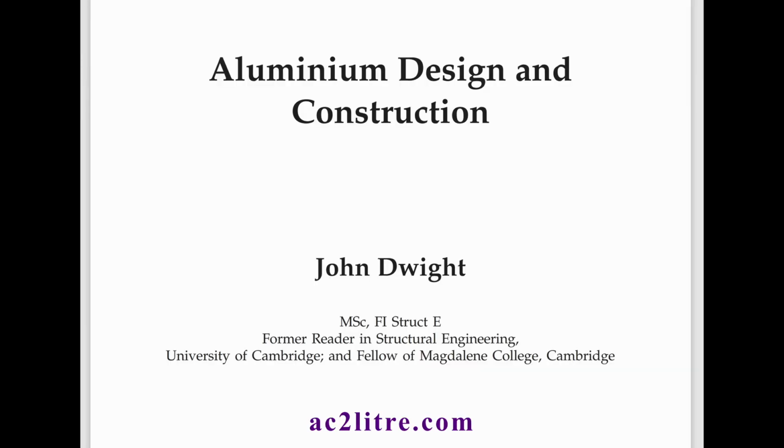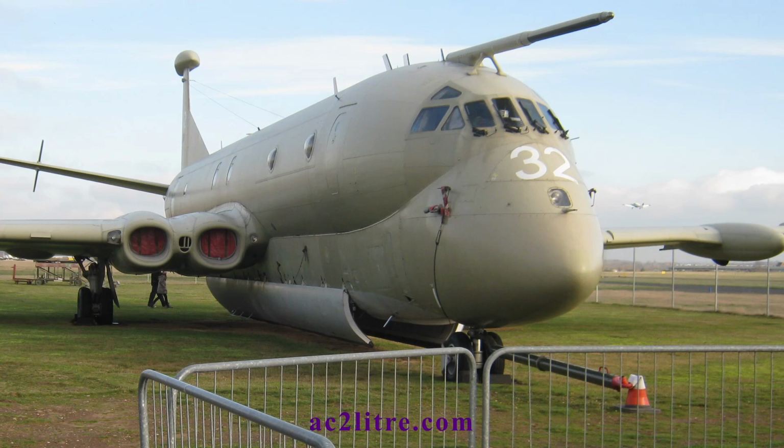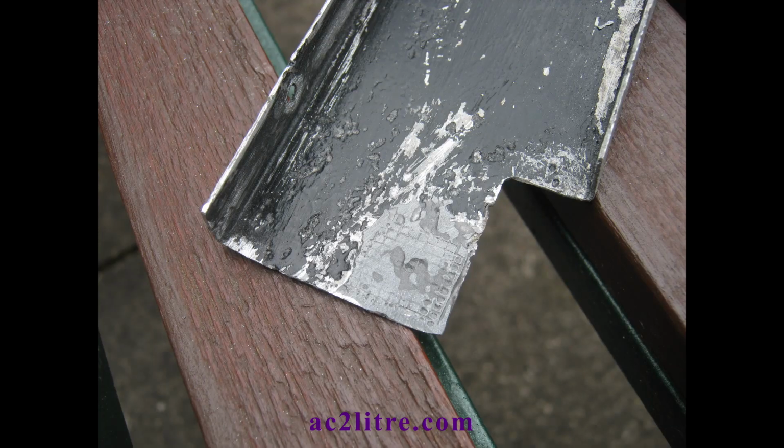Interestingly, the technical data I have on alloys says that this type is not easy to weld, unlike slightly later alloys that don't involve copper. Evidently someone butt welded a lot of panels together on my AC. I abandoned plans to use brazing. Finances were too tight at the time to go and consult any local aircraft technicians, so I did my repairs with epoxy and glass fibre patches.